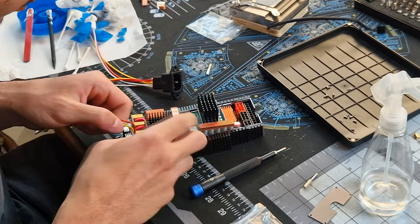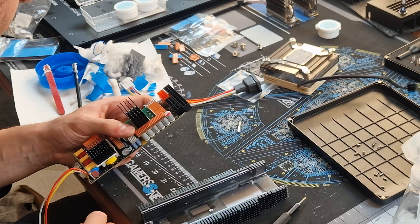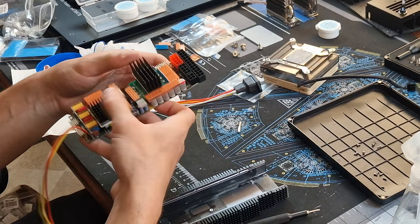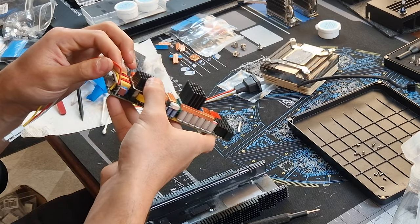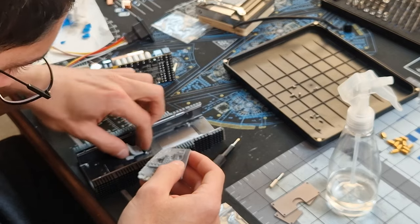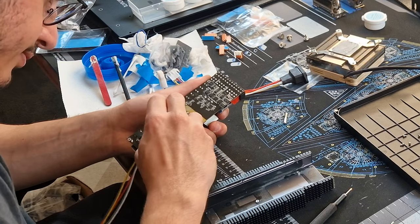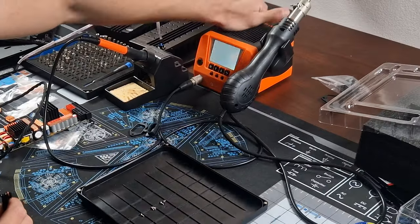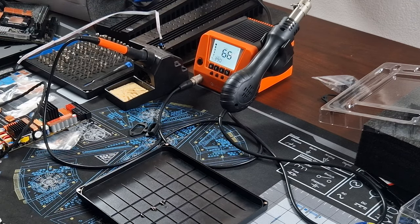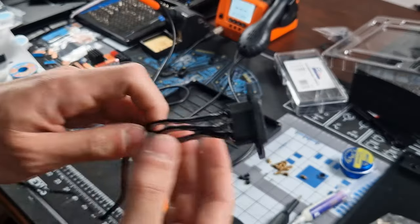Next I worked on the power supply, which I had previously modified with several heatsinks to make sure it could handle all conditions. I decided to desolder the stock cables and replace them with custom length braided ones. I also swapped out the thermal pads with my own and planned to use K5 Pro thermal paste for better heat transfer between the PSU's board and its shell. Before proceeding with the custom cable modification, I prepared all necessary tools: a soldering iron, hot air gun, heat shrink, and of course patience.